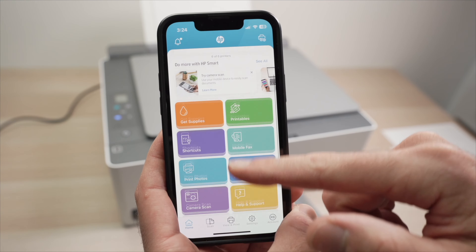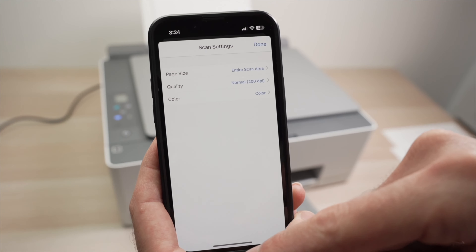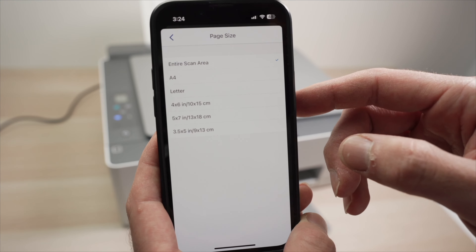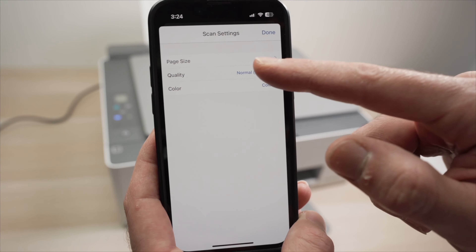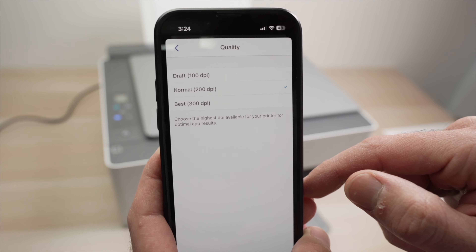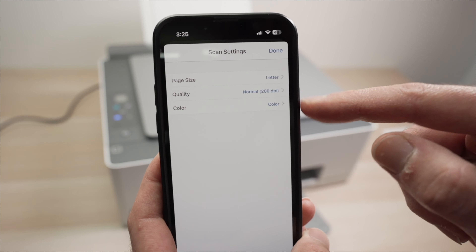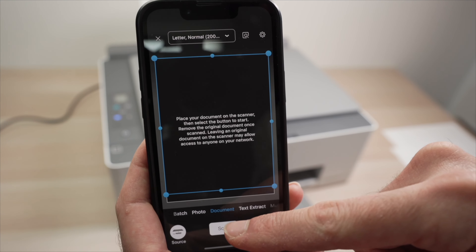On the app's main menu, scroll down and select 'Printer Scan'. At the top you'll see 'Entire Scan' — click it to change settings. For page size, you can leave it as 'Entire Scan Area', but if your paper is letter size select 'Letter'. For quality: if scanning text, keep it at 200 DPI; for pictures or artwork with many details, select Best. Do not use Draft as it lacks detail. Finally, choose color or black and white, then press 'Done' and press the 'Scan' button.